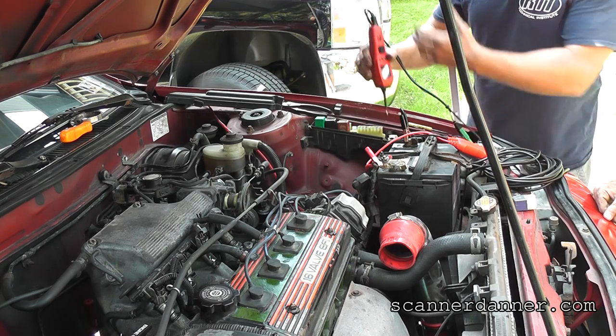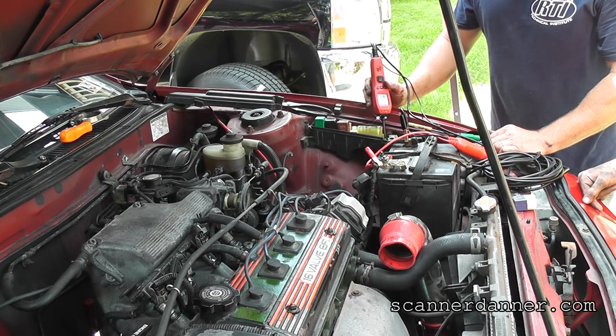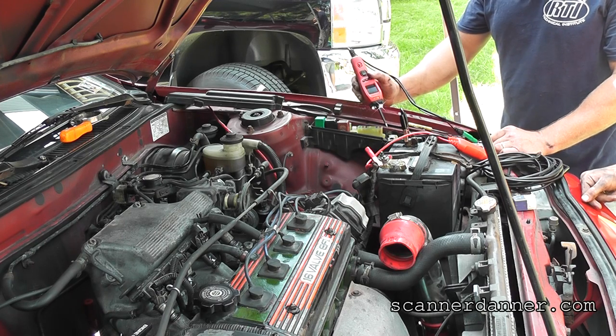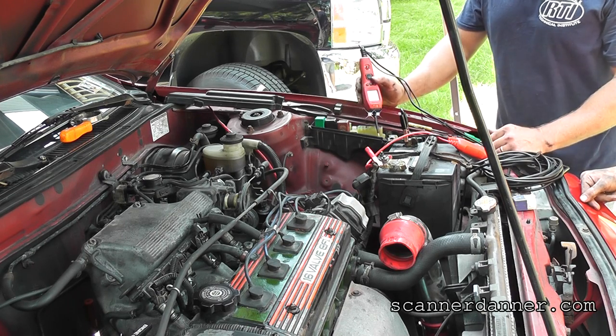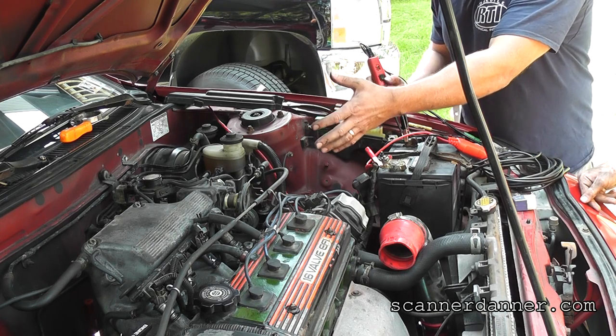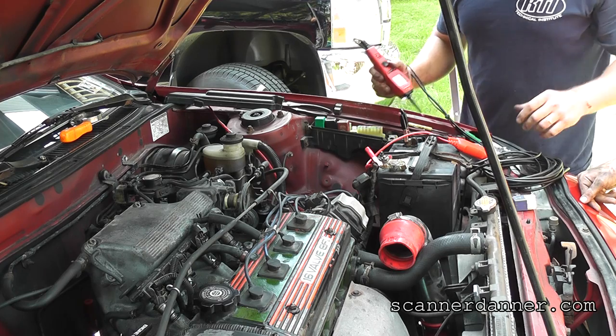And then we would just segment it along the way. I test myself, really. No, but you're learning that this is what we're doing, and voltage measurements are how you troubleshoot a circuit. Our voltage was good out here. Our voltage was good down at the starter. We had a good ground. We were done. We put a starter in it.